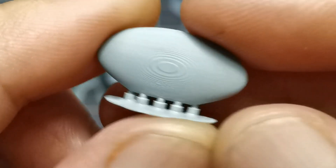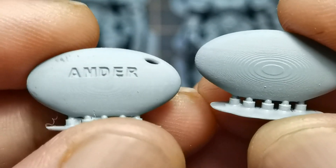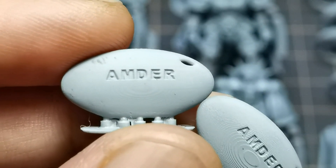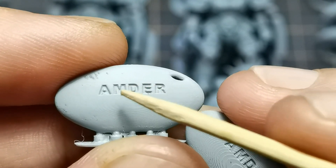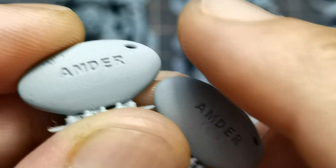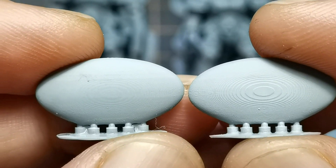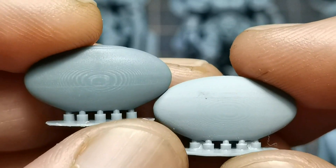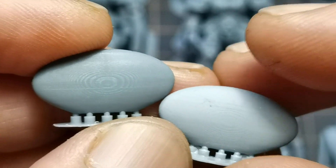Now we shall see the anti-aliasing on Mono X with 1.6 second exposure compared to no anti-aliasing. You can see that the edge of the fossil here is quite blurred, so the unofficial firmware is starting to have working anti-aliasing. Yes, much better — anti-aliasing works on firmware 3.5.4. Comparing the 1.6 second to 3.2 second exposure, the result is pretty much the same — the edge of the fossil is blurred, not as sharp as the no anti-aliasing version.